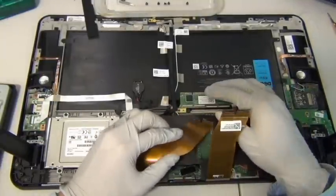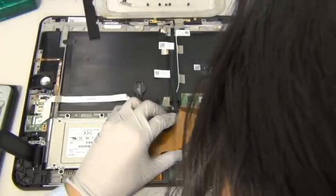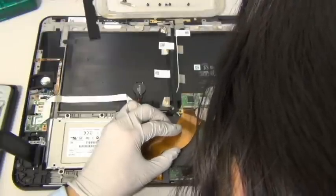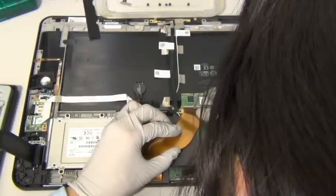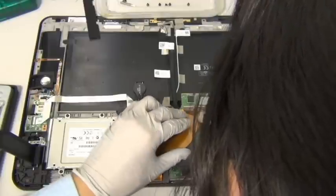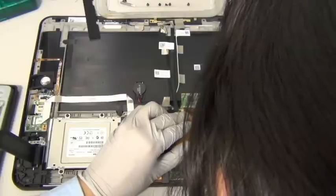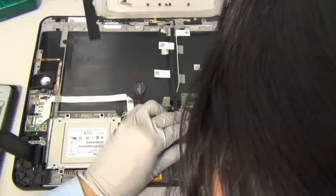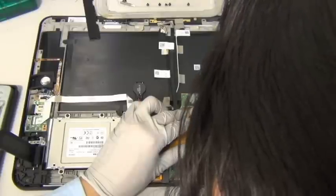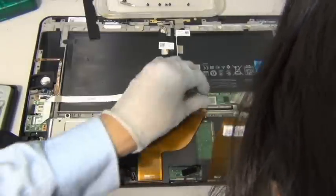Again, you want all these PC flips to be up. They look like I guess 30 or 40-ish, 35 maybe connectors. Don't quote me on that because I can't really tell, I don't count them. So we just put them in gently. This thing really sucks when they break and they're so fragile, so we wanna be very gentle and clip them down. Always do that in the center, don't do that on the side.